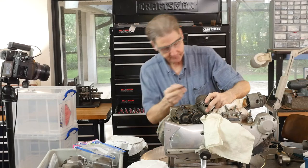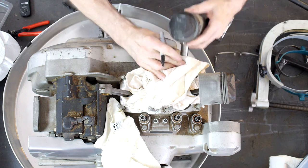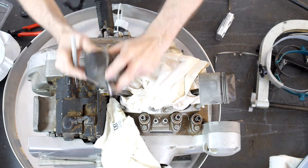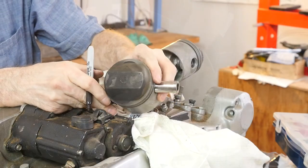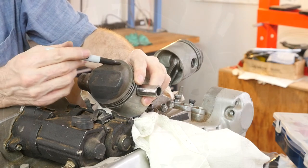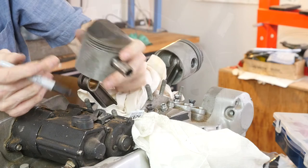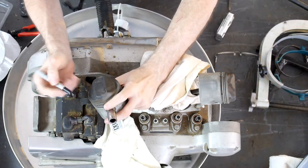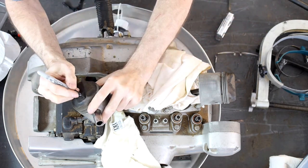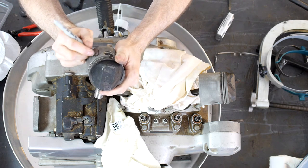This is the rear piston. And you'll note — there's a little divot right here. That's the intake side because the intake valve is a lot larger and needs clearance. So as it was in the correct position, the little divot is on the intake side. No divot here — Rear. So you've got to at least mark it, because you can put it in like this on the front. Mark it Rear — no shame in writing on the side either.